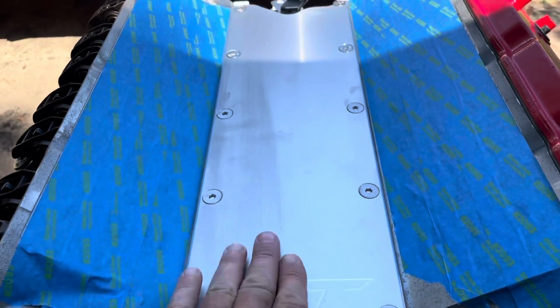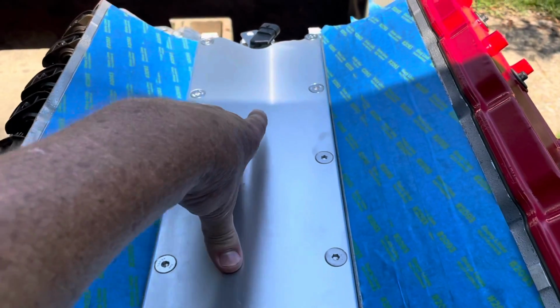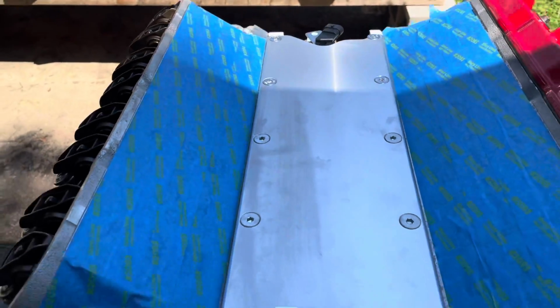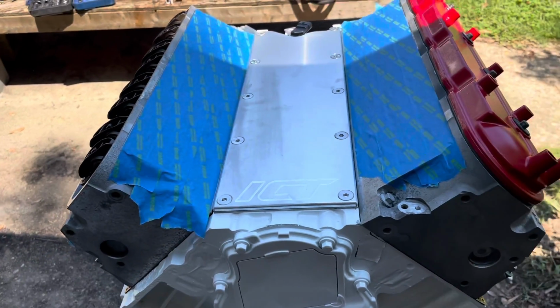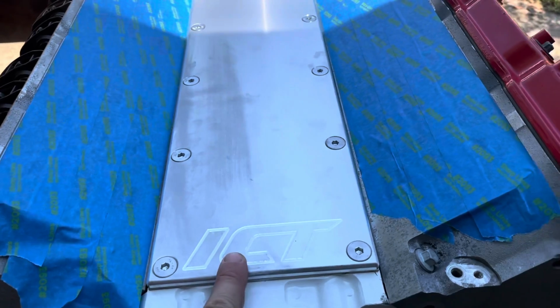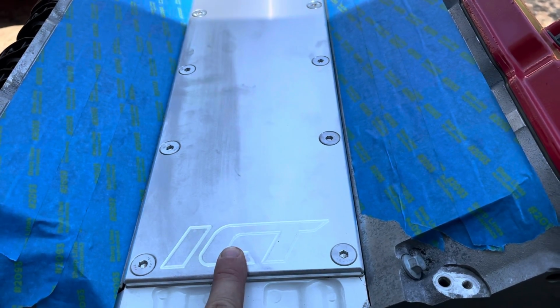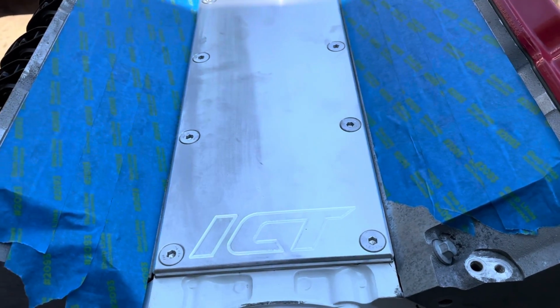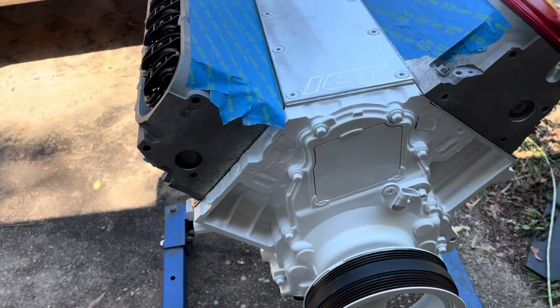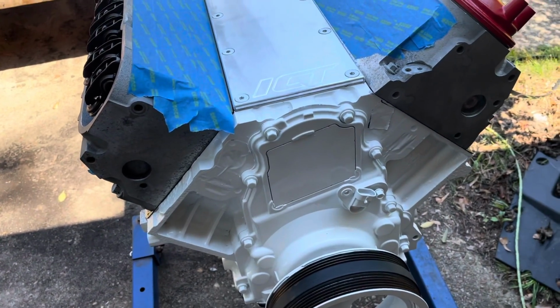You have to use a valley cover that covers up your knock sensors, but also leaves you a gap for your cam sensor right there. So I'll put the part number to this part in the description of the video, so you know what to order if you need to buy one. And like I said, I got it from Summit Racing for approximately $38 plus shipping. Actually, I think shipping is free because I always combine my orders, get over $100, so I get free shipping.